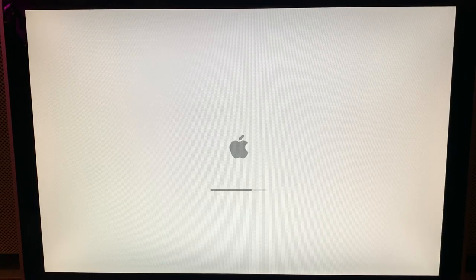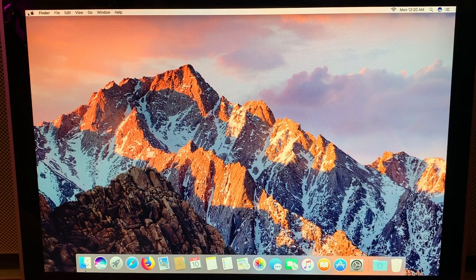And you'll notice here, this system still has the original Wi-Fi card in it. And Sierra doesn't support this Wi-Fi card. But if you notice right up here, it's connected and it works. And that's because of the High Sierra 4321 or whatever it is, the 21 Broadcom patch for High Sierra. If you boot into the High Sierra drive and run the patcher on the Sierra drive, you can install the patch. And this patch was also created by Ethan Nelson Moore, a.k.a. ParrotGeek. He came up with the way to make it work.